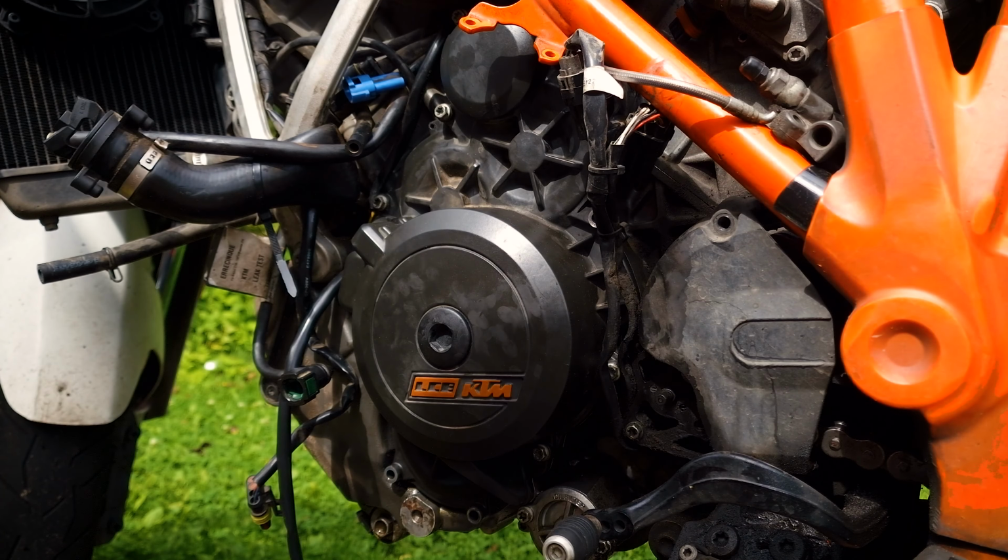Of course, the cover will have to be tightened with a torque wrench. As always, crosswise, and then you have to check several times, because the cover presses the gasket and loosens the tightening of the bolts. Well, you all know that. Since we got into the chain, we will clean everything here to be clean and nice.